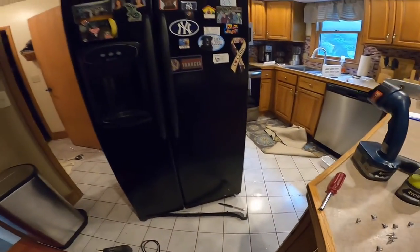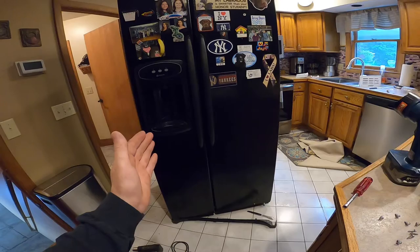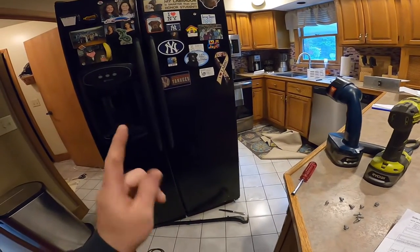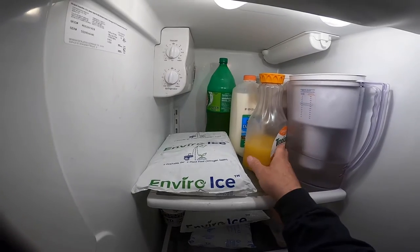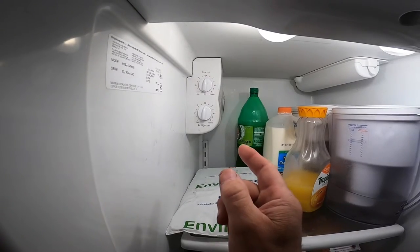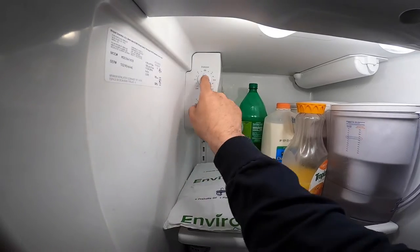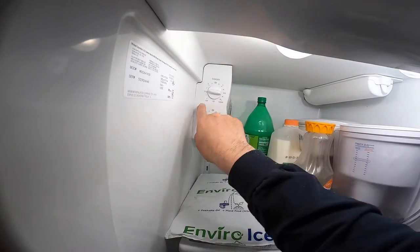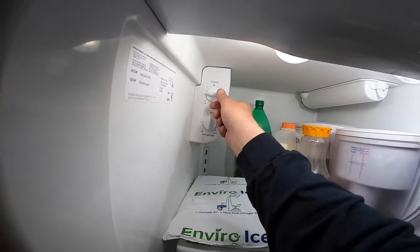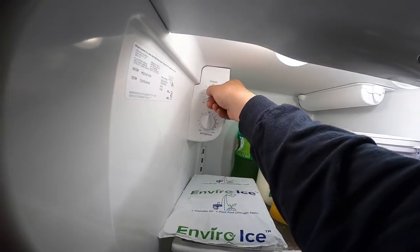I'm going to plug the thing in and then check to see if the actual coil is good. I'll hit defrost mode — go from cold to off three times within six seconds: one, two, three. That is stone cold still. So there is a thermostat defrost resistance mode — I can get the ohm meter. If it's above 42 degrees Fahrenheit it should be open, and below 12 degrees it should be closed.